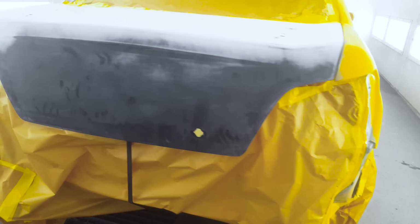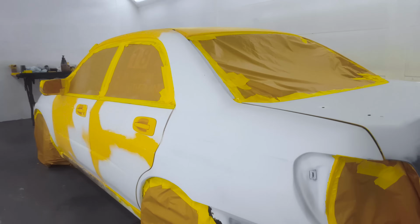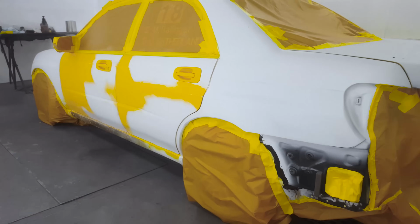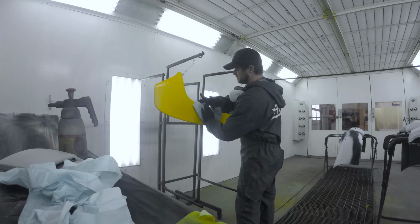Most of the videos you've seen from my channel and probably many others are a little different in the sense they'll have a multiple step system with the base coat, which is the color, going down first, and then the clear coat. So in a single stage, you have that color mixed into the clear coat for a one step application. Now, I do say one step application.